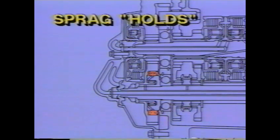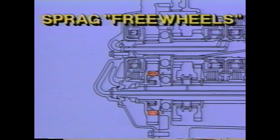To accomplish this, a sprag clutch is used in the first speed driven gear on the output shaft. During acceleration in first gear, when the shaft speed is increasing, the sprag holds the first speed driven gear to the output shaft. During deceleration, when shaft speed is decreasing, and in second, third, or fourth speed ranges, the sprag releases and freewheels to prevent bind-up of the transaxle caused by having 2 speed ranges engaged at the same time.